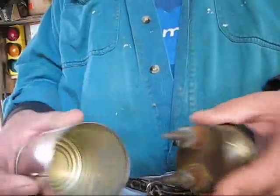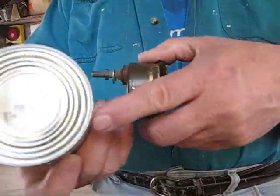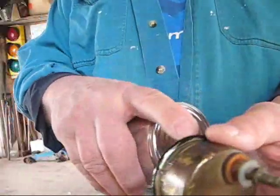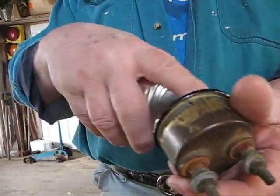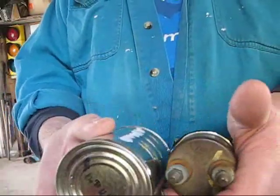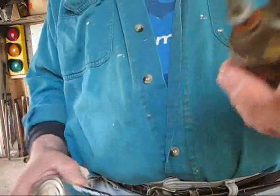I'm going to make a holder out of this tin can. This gauge fits down in it right nice. I'll poke two holes in the bottom of it and trim the edges of the can around here. It needs to not be completely covered over because you have these little light slots. The way you light these gauges, you put a light in the back of the dash and it shines through the glass. So probably what I'll do is notch the sides of the can so as not to mess up that light slot. I'll show you what it looks like when I get finished and then we'll put it in the car.